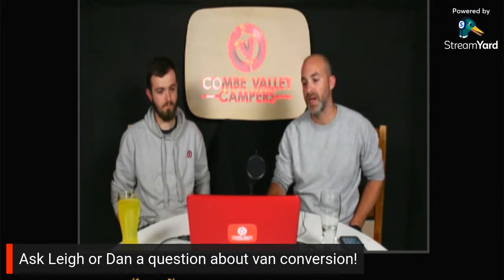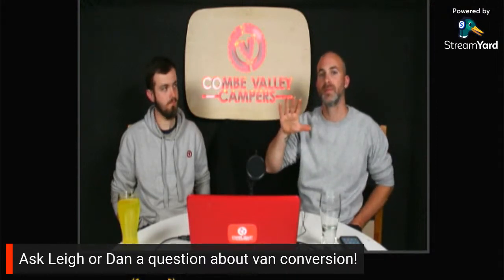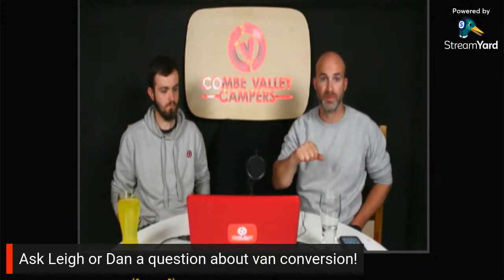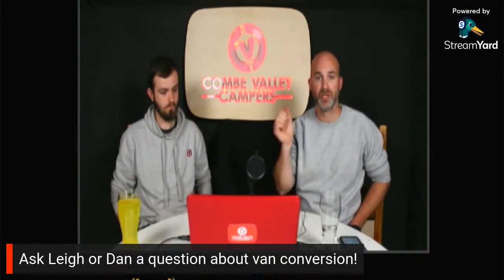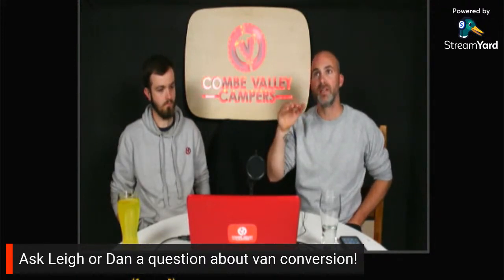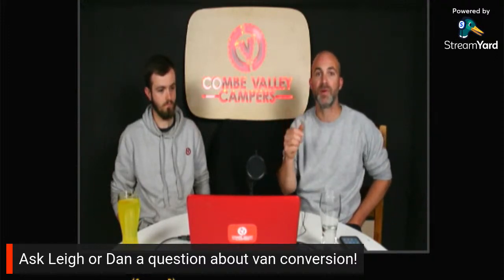As a quick rundown, you carpet the whole door panel, and then shut the door. Make sure it's dry or indoors, but shut the door with the carpet sort of hanging out. Then the rubber seal against the carpet will leave a depression on that carpet. It's a telltale sign of where the rubber has compressed the carpet.